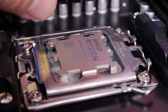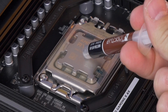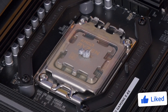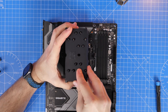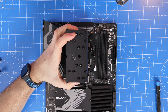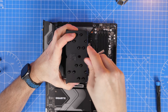The little plastic housing basically sits over the top of the CPU around the edges and notches into it. Then you can put your thermal paste on the CPU as usual. Note that in this video it looks like I'm putting it on plastic, but I'm not — it's going directly on the CPU as you usually would. You leave that plastic shielding in place, seat your cooler down over the top, and then even if you've put too much on, it will spread to the edges and end up on the plastic rather than going down into the notch areas on the CPU.